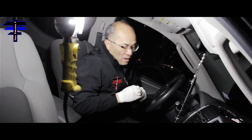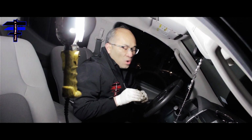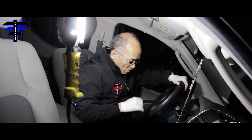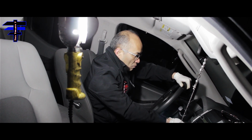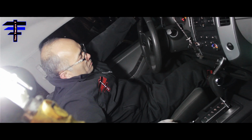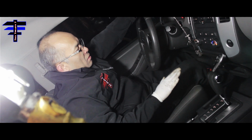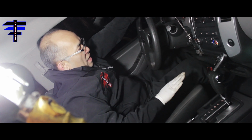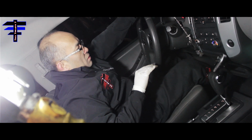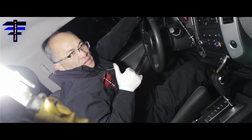So what I'm doing now is pressing the brake pedal. Make sure it's tight before you go for a test drive. Start the car. So what you do is just pump the brake. Push back in, come back out, push it again. You can feel it, it's very tight, so you should be all set to go. Alright, we're good for the test drive. Let's do it.